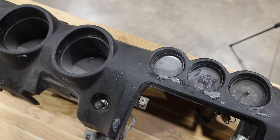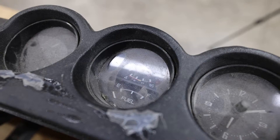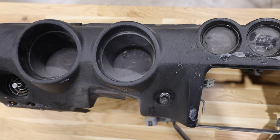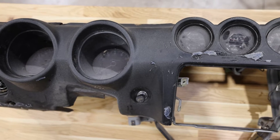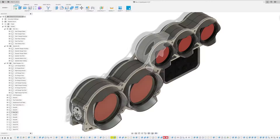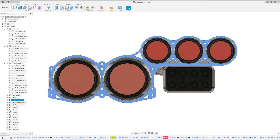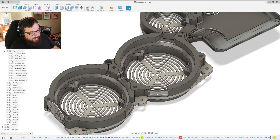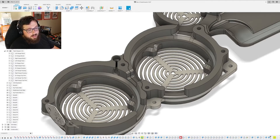To summarize where we left off, we're replacing the Datsun's original dashboard with a custom 3D-printed gauge cluster. I wanted to come up with something totally unique that was unmistakably something meant for an early Z car. After spending several days with Fusion 360, I came up with this design that I am super, super proud of. We'll be printing the front and back halves for each of the gauge pods — 10 pieces altogether. The pods are then all joined together by a large laser-cut aluminum frame that's going to be bolted straight to the roll cage. I've also released a full video going through the concept and CAD modeling for anyone wanting to see more on the design.